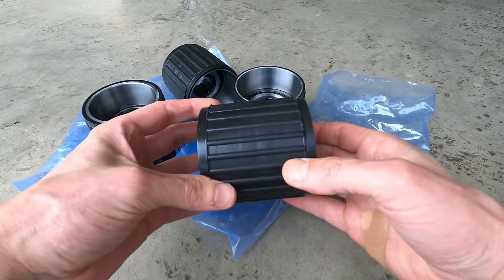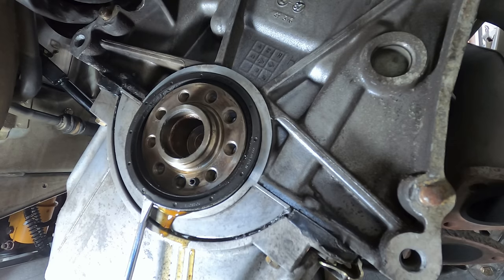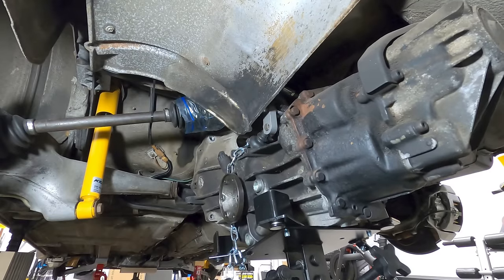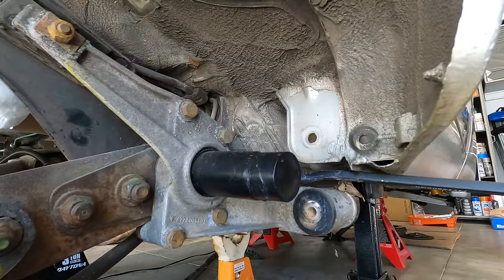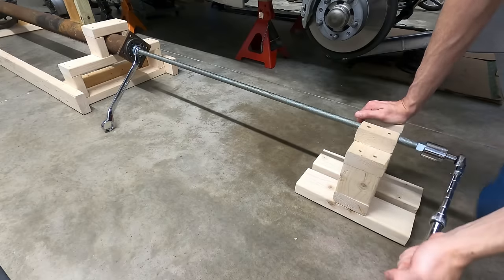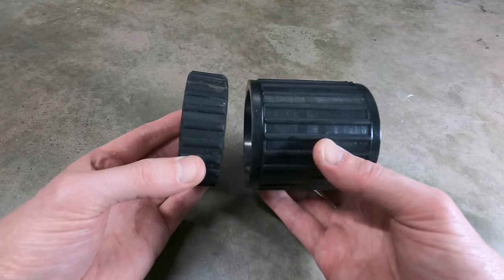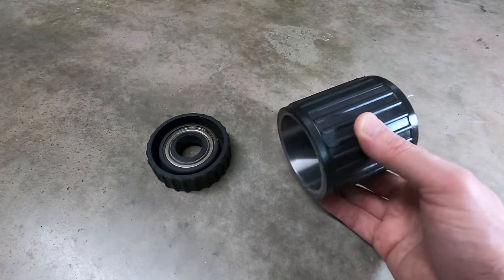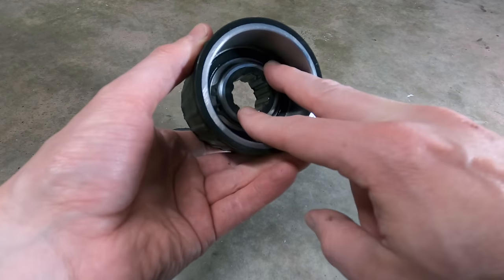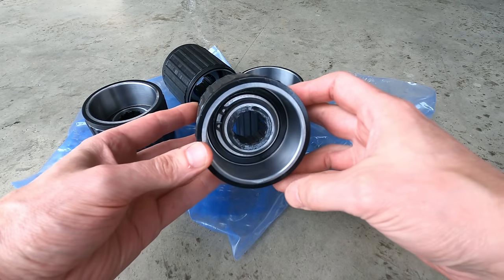Another modification that no one will ever see was the installation of a set of super bearings from Black Sea R&D. While working to replace the clutch and the rear crankshaft seal, I discovered that the torque tube bearings were showing signs of failure, so I rebuilt the entire assembly with these improved and more robust aftermarket bearings. A torque tube rebuild is fairly involved — the transaxle needs to be completely removed, the rear suspension unbolted and lowered about 8 inches to fully remove the torque tube, not to mention the slow process of extracting the factory bearings by wrenching on a 6-foot threaded rod for about an hour. The super bearing housing provides a larger surface area of rubber exterior, which secures the bearing unit in place and isolates more driveline vibrations, and the larger insert better supports the drive shaft, absorbing driveline vibrations caused by the shaft under operation. When it's all said and done, the super bearings will probably outlast the useful life of the car.